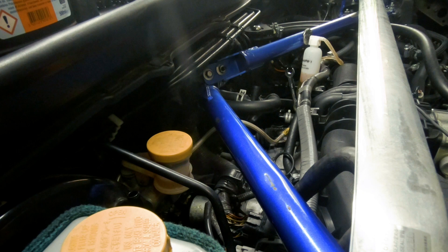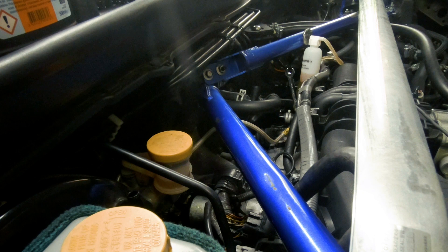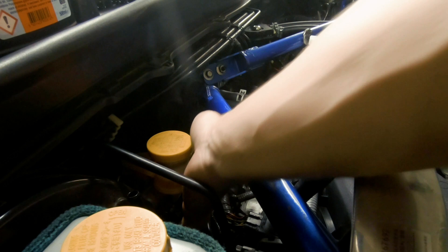I've now made a mess — the bottom of this over here has popped out, so I need to get it out again. Once you're happy that there's not much more air coming through, close off the bleed valve and then pump the clutch up until it gets pressure.